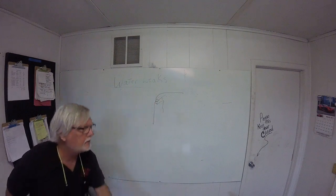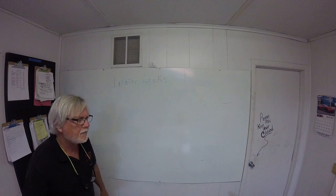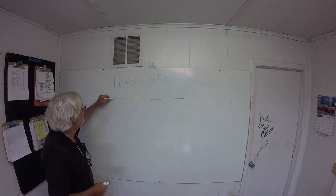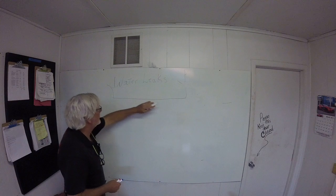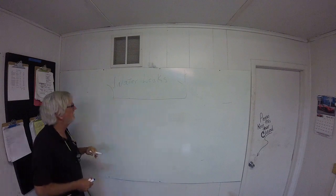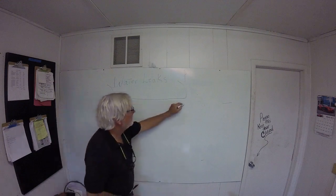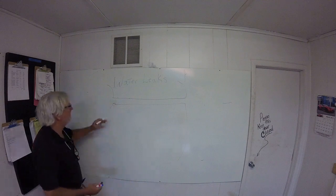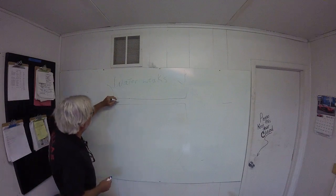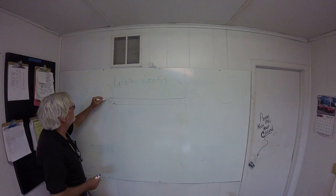So you say, well, why in the heck did they build it this way? Hey, this is not simple. This is like, wow, what's complicated? It's because it's a system, okay? The top of the coach comes down and is riveted to this hollow extrusion. The bottom, there's a groove that the bottom panel sits up inside, bonded in there. Okay? And then you have all these screws right along the middle of that visible hollow extrusion.